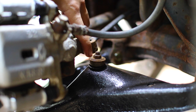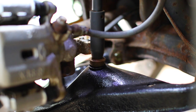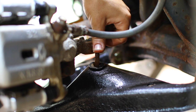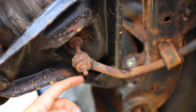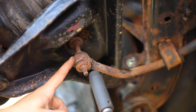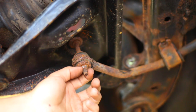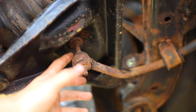I'm going to start by removing the nut from the top of the end link using my 12mm socket and impact gun. We have the little nut and the metal piece that goes over top of the rubber bushing — slide that out and everything is removed from the top of the sway bar. On the bottom side we have the exact same setup: the end link, that same 12mm nut, the metal piece, the rubber bushing, and then the sway bar. These are a little too rusty to take off cleanly but I'll move on since we at least have one of them out.